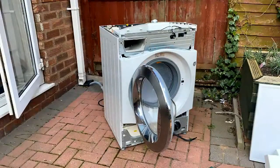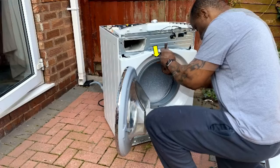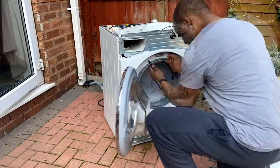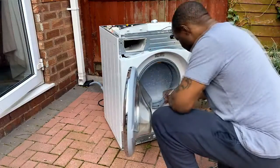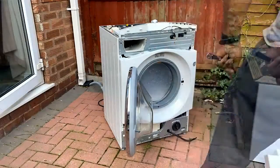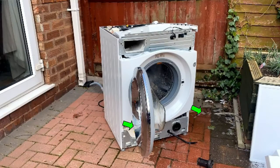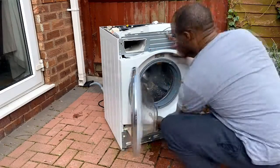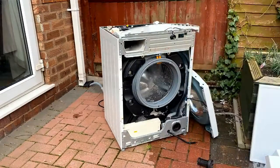It's got a bit of water left in it. There's a ring that goes around the door seal with a spring on it — I'll give you a close-up. Remove that retainer clip and push the door seal in out of the way. Since it's outside I can let the water at the bottom drain. Just pull the bottom out slightly, then lift the whole thing up — hook the top hooks, pull the bottom out, lift it up — and tuck the door housing to the side. There's a connector for the door switch but I'm going to leave that connected.